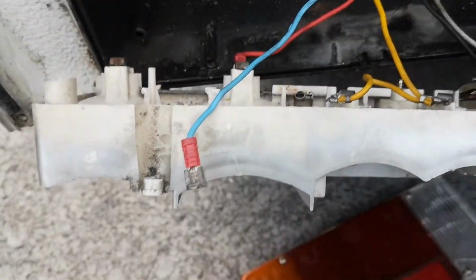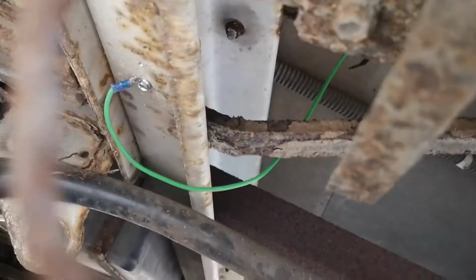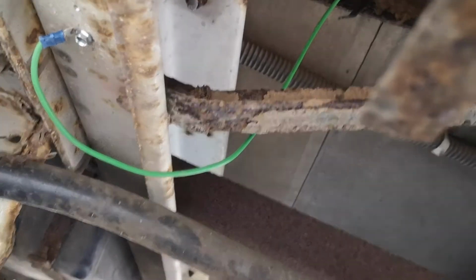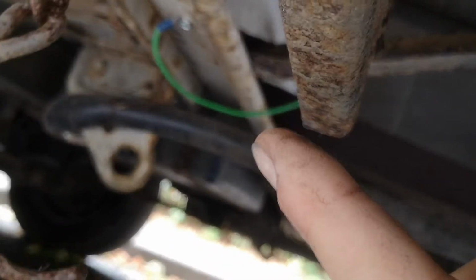Now that's generally due to a poor grounding, and we can see on the underside that's the connector plug for all the wires to the rear light unit, and someone's actually had a go. So they've found issues before, actually had a go at grounding to a chassis point there, unsuccessfully obviously, and I've tried putting a jumper from that nut to the grounding plate inside. So the bulk of that, hopefully you can see the corrosion, the old ground point's gone, so it's all mackled up.